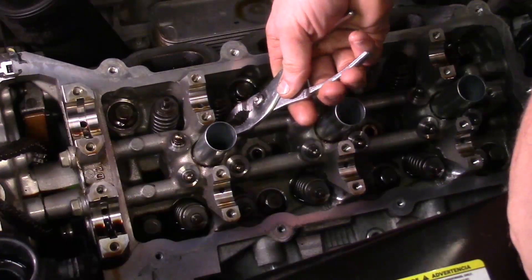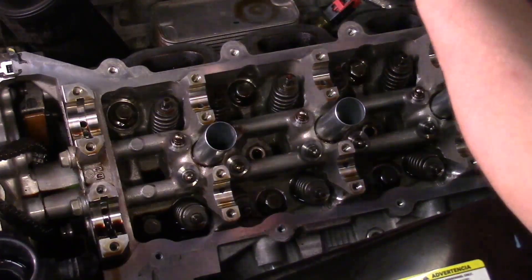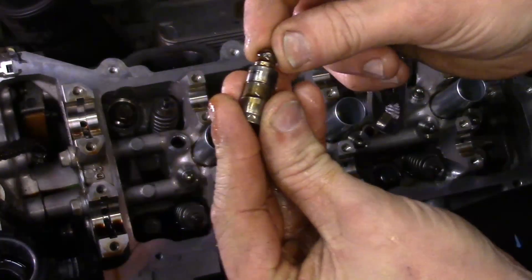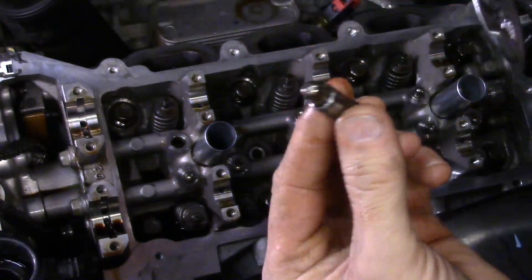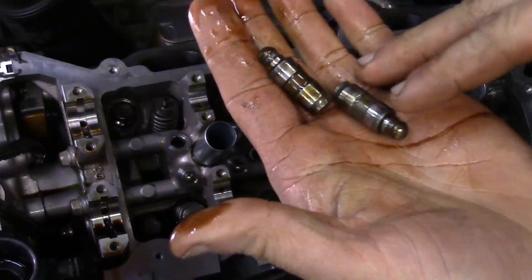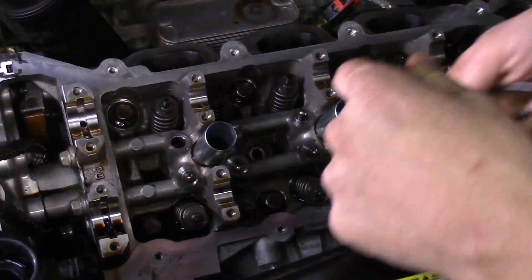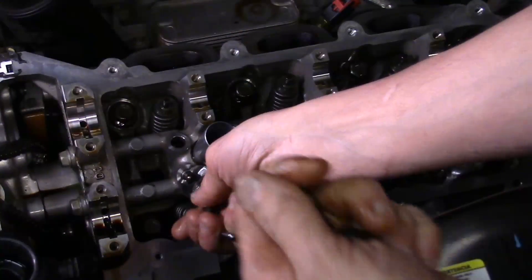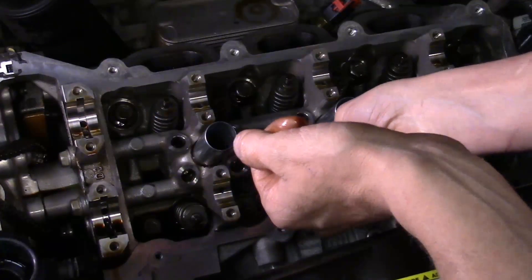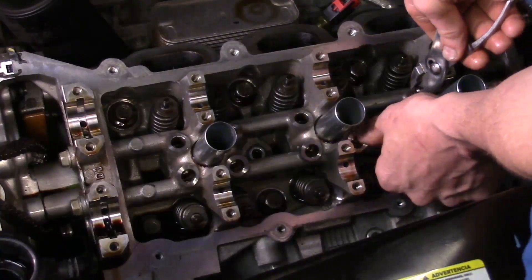I'm going to get a small pair of pliers to grab onto the lifters. The lifters are right here towards the center, right around each spark plug tube — there's a total of 12 of those as well. Just lift straight up. Take time to look at them; make sure they don't look abnormal. Compare to a couple more — if you see anything that doesn't look the same as the rest, then we've got an issue. You'd expect a noise or misfire code. I wouldn't be too concerned which cylinder they came out of; just throw them in a pile and insert them in any one of the holes when you reuse them.